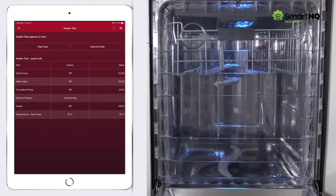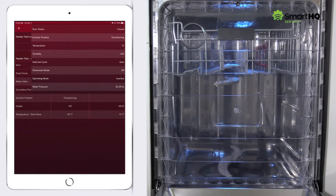Press the Start key and the drain pump motor will run for approximately one minute. This will ensure the dishwasher cavity is completely empty. The status column will indicate the initial temperature value the thermistor is detecting — take note of this initial value so you can see if there's a change in temperature later on. Once the drain pump stops, the water valve will be activated. While the unit fills, let's open up the watch box so we can monitor other components.